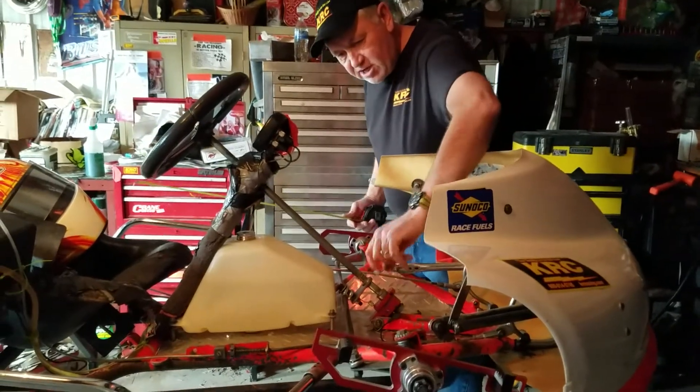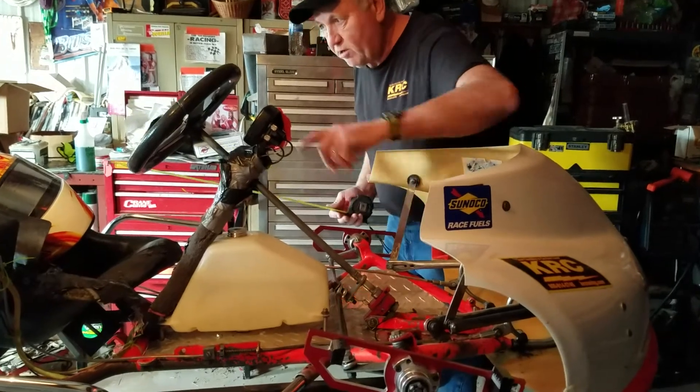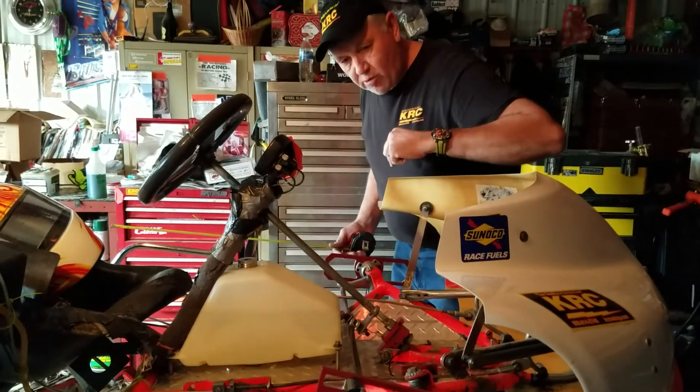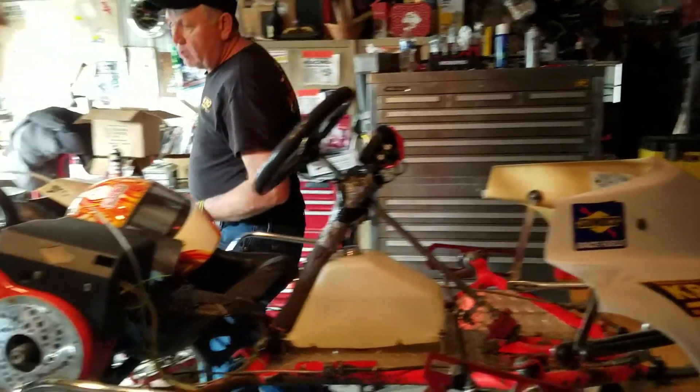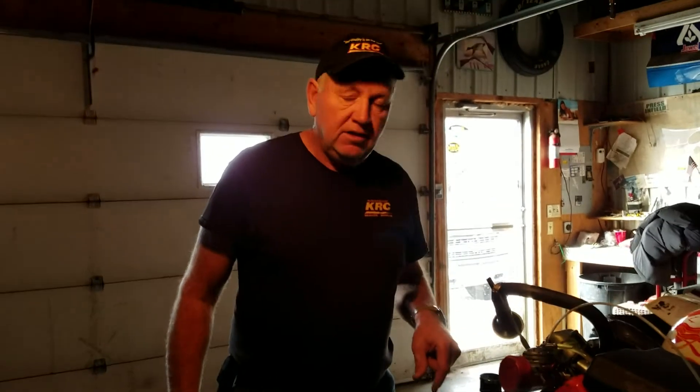If you're out, you're going to adjust your tie rods, whichever you want to make this be square. So now the rear end is square with the front end. And this is our laser toe. Please feel free to go to krcracing.com, and thanks for watching this YouTube — we'll see you at the races.